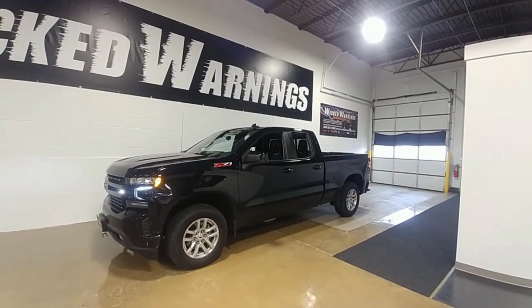A couple of other items we're going to put in this kit for you. We're going to put in some primer 94. That's to better bond those front mpower lights. We'll put one package of that in there. And we're going to put an assortment of 1/8 inch and 3/16 heat shrink, as well as some uninsulated butt connectors. Those are going to be helpful when you're making your wiring connections. The 1/8 inch heat shrink and 3/16 is adhesive lined and 100% waterproof. So as I said, there might be some terminals or some split loom that you're going to need to do on your own, and you'll have to supply that.